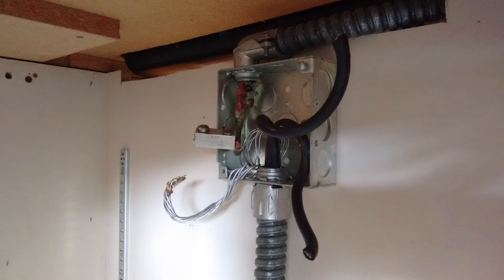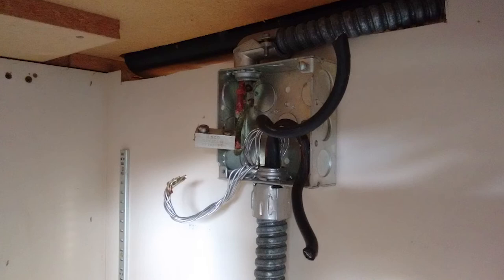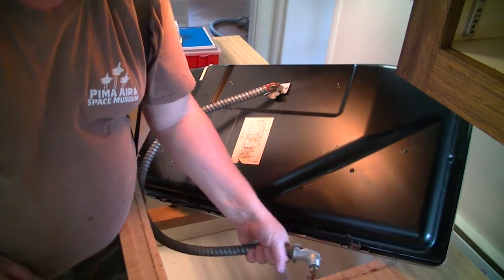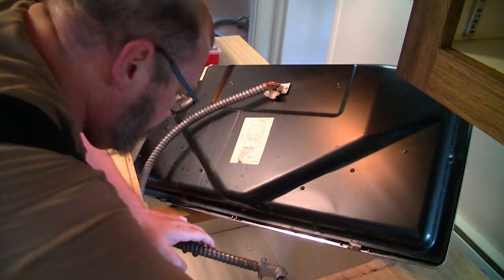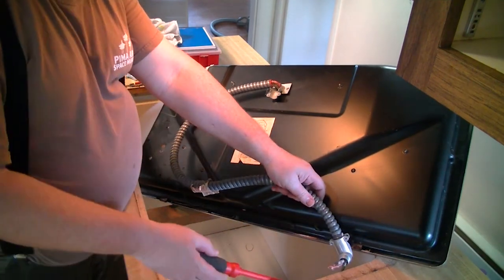What I did in this case was: I had three wires coming out of this connection in the top, connecting up with two hot wires and one neutral wire. I put wire nuts on the end of these two 110-volt lines and taped them on there with electrical tape, then proceeded to pull everything out. This circuit has been marked off in the circuit panel down below so that if anyone wants to mess with it, they will know this circuit is off. With that, I proceeded to get this cooktop disconnected — I just used my lineman pliers, snipped them off just like so.